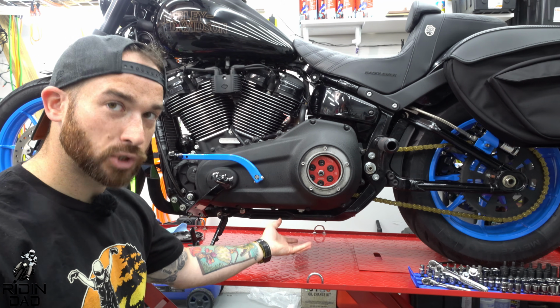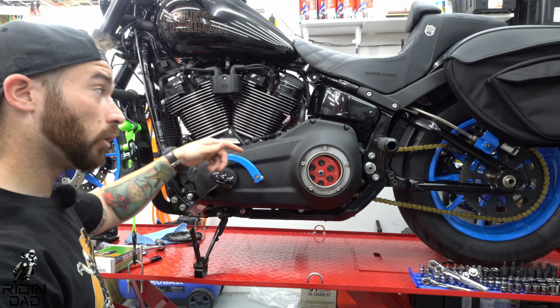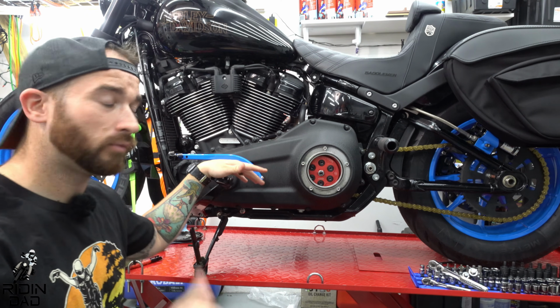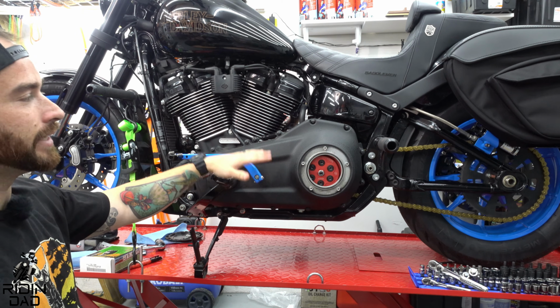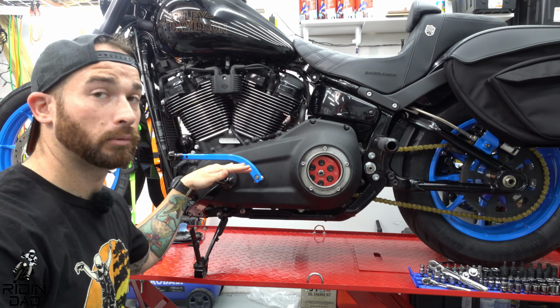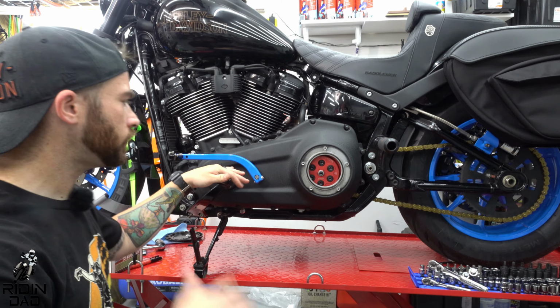If you took it out, obviously you needed to drain it. Go ahead and make sure you put it back in before you put oil in. Then obviously put in your recommended oil, like you saw me do, the recommended oil and recommended amount of oil. It might change, especially if you do as many different things as I did, either a different size clutch basket, with more material, or a different size. We cut down a considerable amount of material for the Man-O-War compensator.